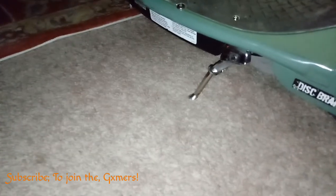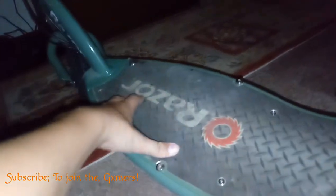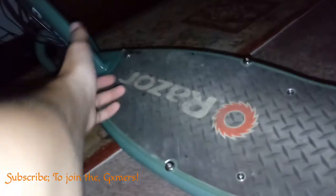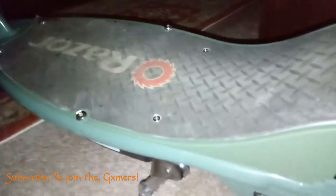I'm planning on putting a better speed controller, a better motor, and basically just gutting the whole thing from the inside and putting a better motor and a better battery — probably a 36-volt battery, something like that. A 40-volt motor which actually goes 30 miles an hour. Put a powerful motor on this thing, put the gear from this motor, same chain, and then we'll have a scooter that is better. I can get a more variable scooter speed controller — a more powerful, higher-voltage 36- or 40-volt speed controller. If I can go 40 or 48-volt, I'll do that.